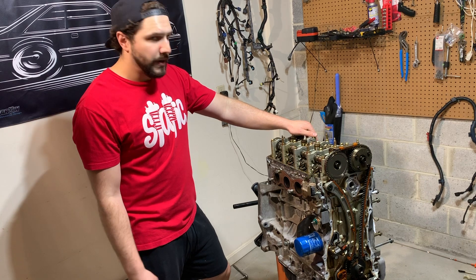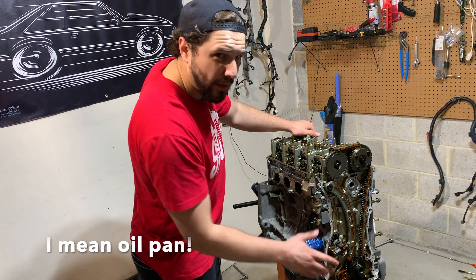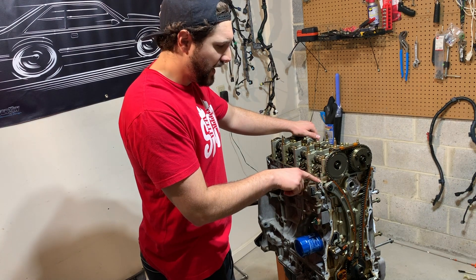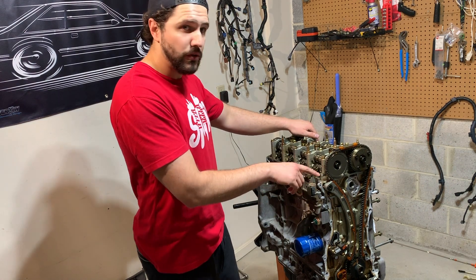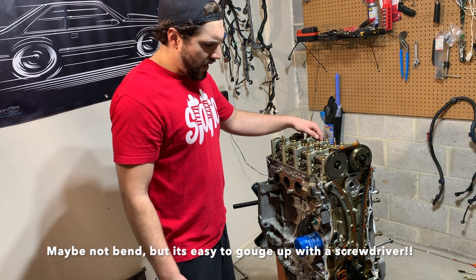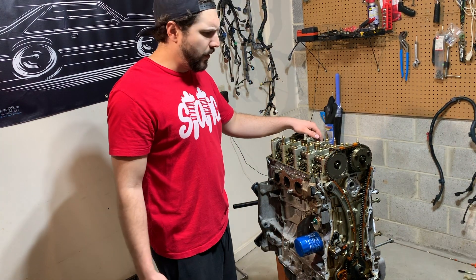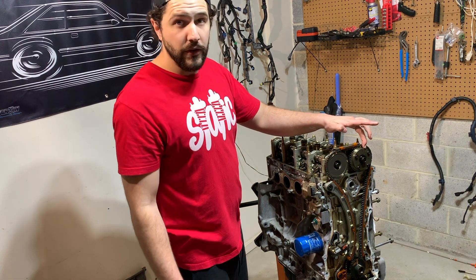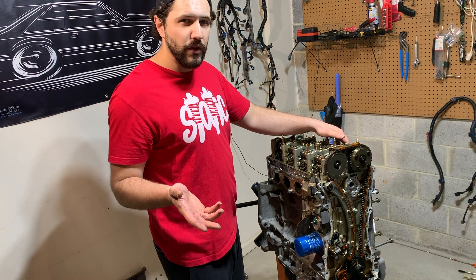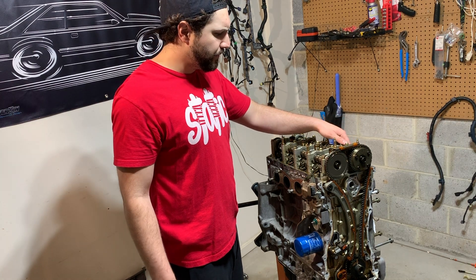So that just about sums it up. We got the engine taken apart where we needed to be. Now we can install the cam gear and tensioner — still need to get the oil pump off. I had a fair amount of trouble getting these Honda bonded parts off. I'm so careful with this aluminum — I don't want to chip it or bend it, it's so soft. If you try to pry it with any force, you'll bend and chip it right up. So in the next video, I'm probably going to install the 45-degree VTC gear and talk more about how beneficial it is. Honda has a really good article where they did a test between a 25-degree and a 45-degree cam gear. I'll see you guys in the next video.